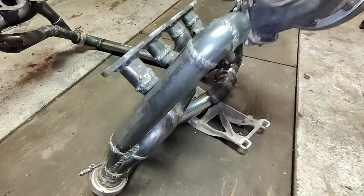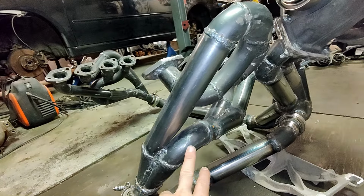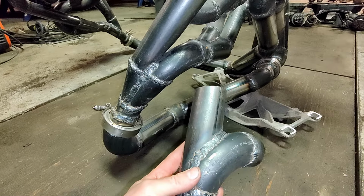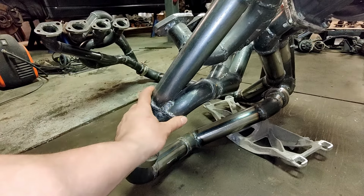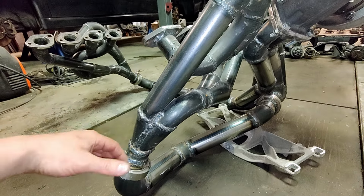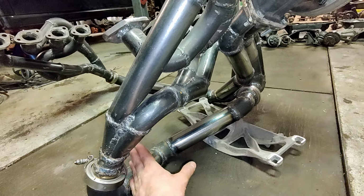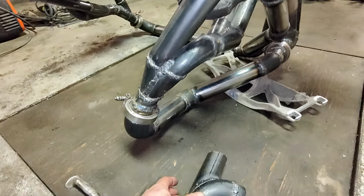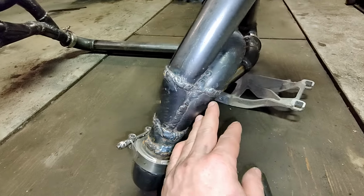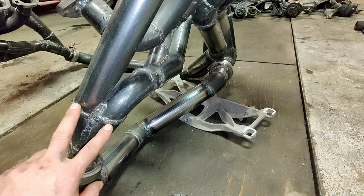What happened in my case was that the two first cylinders firing in this pipe were backflowing into this pipe. And the reason was this. This is a really narrow spot in the engine bay. We have a chassis beam here, starter there, gearbox here, downpipe coming down from here, and you know, this is a really, really tight space. The subframe is here, actually very close to the flange. And what happened is that I reserved too much space in the width direction. So as you can see now, I basically have the full bend profile here until they merge these two pipes.